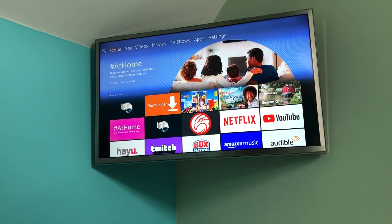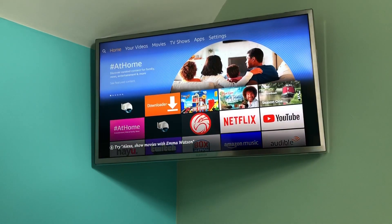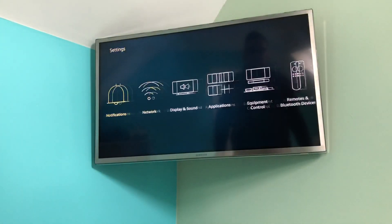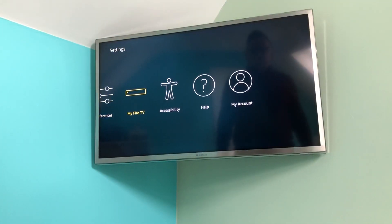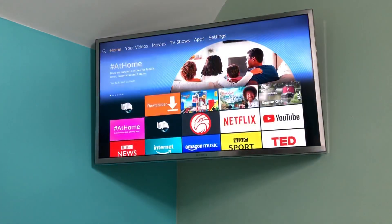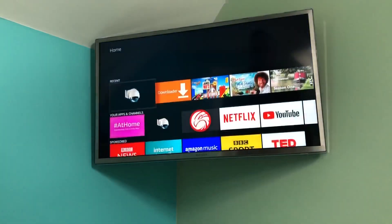You'll also need a Bluetooth mouse because some bits you can't get to - you need a sort of touch screen on the app when you go into it, as it's a phone or tablet version of the app, and you can't get to the accept button. You'll also need to go to your Fire Stick settings, into My Fire TV and Developer Options, and make sure both options are on. You may have to accept responsibility for anything that goes wrong.